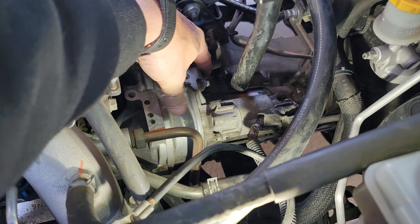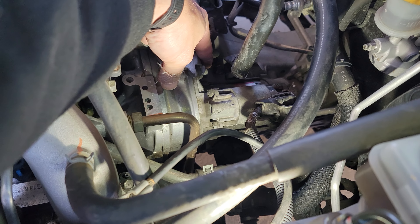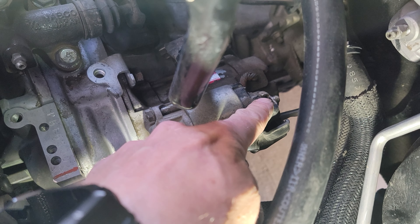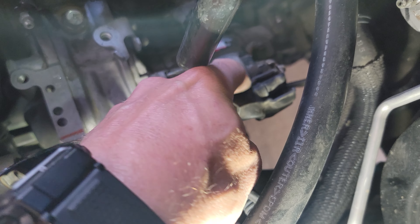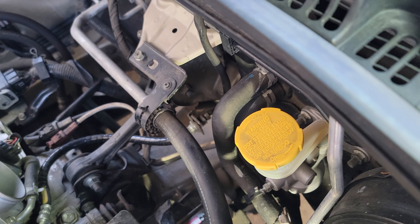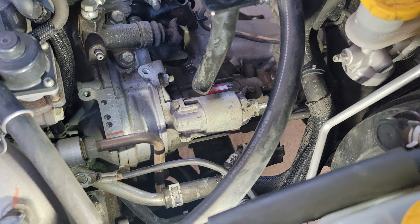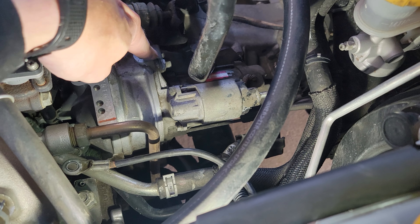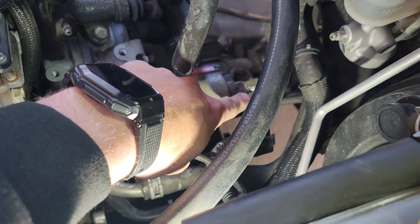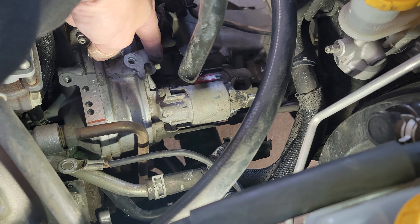These are going to be 14mm bolts — they should be pretty tight. Make sure you have a good grip so you don't round off these bolts. We're going to remove these two 14s, and then remove this backside one — that one is also 12mm. Pay attention to this little clip; that needs to be back in that same notch when you tighten it up. Disconnect that before you take your bolts all the way out, and remember that this bracket is going to come off when you take out the starter — it needs to go back exactly where it was. So: 12mm here, 12mm here, 14, 14.